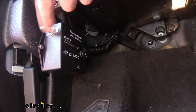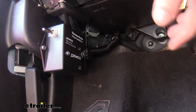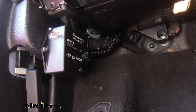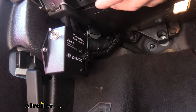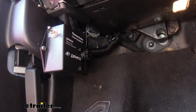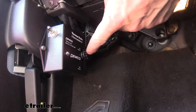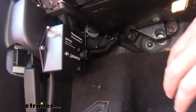When driving normally you want to make sure the system is disarmed in the off position — this way there's no way the system can activate when you're out on the road. When you're ready to flat tow, switch it on to arm the system. Now it's going to be looking for brake signal inputs from the motorhome as well as monitoring the inertia sensor to determine when to properly apply the pedal. You'll also find your sensitivity adjustment on the side of the box, where you can determine how aggressive the pedal applies.